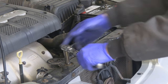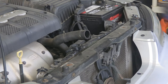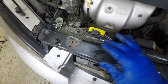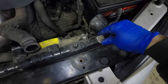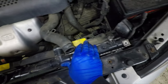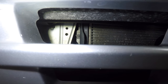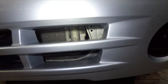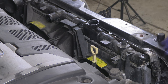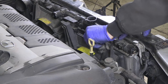Next, we're going to remove the radiator mounting brackets, one and two. But the radiator still doesn't want to come out. The condenser for the AC system is bolted to the radiator and sits right in front of it. There is a second bolt, so let's remove those two. The radiator is moving around a little more, but something is still holding it. Looking through the bumper, we can see there are two more bolts holding the condenser in place from the other side. I was trying to keep the fans on the radiator to remove them together as one assembly, but I'm going to have to take them out to get to those two bolts. Fortunately, these fans are bolted to the radiator only at the top, so they're fairly easy to remove.